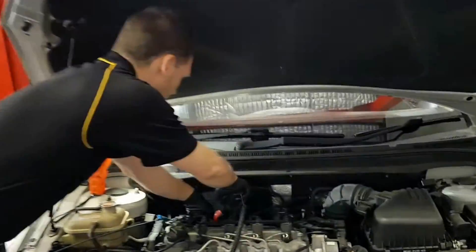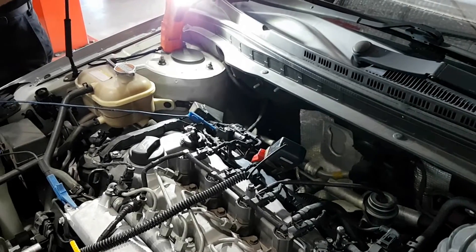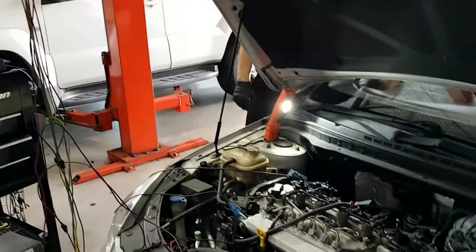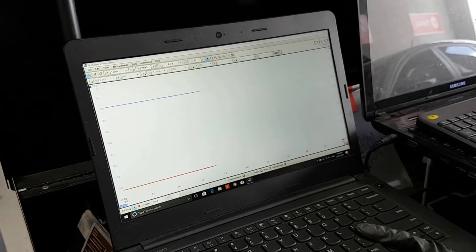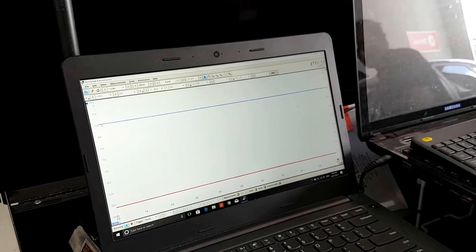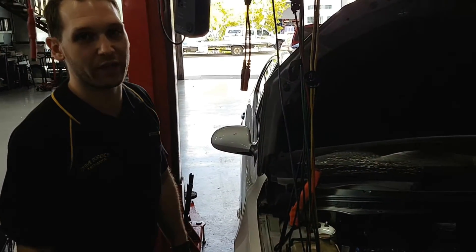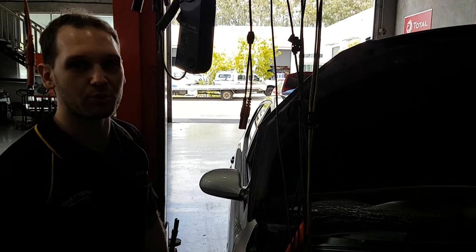I'm going to put this on — the current clamp could be going negative or positive polarity, it just means it'll show up or down on the graph, but not a big problem. I'm going to turn the ignition on. I can see my 12 volts there, and I'm getting no amperage at all. You can draw cursors in and that kind of thing, but we're down here at nothing, whereas up here I am getting 12 volts. I'll start the car just to see the point — you can see it turned off because the ignition was on for so long. I've started the car, still nothing happening. So I'd be quite confident in saying to the customer that we've got four dead glow plugs. You can take them out and do your own tests, but it's a quick, easy test to show that. I'll get the new ones and we'll review the test.